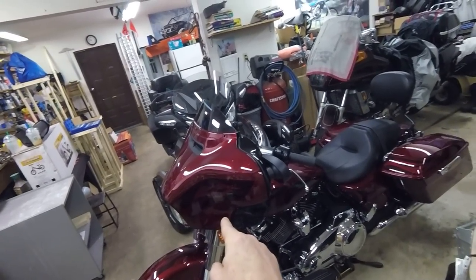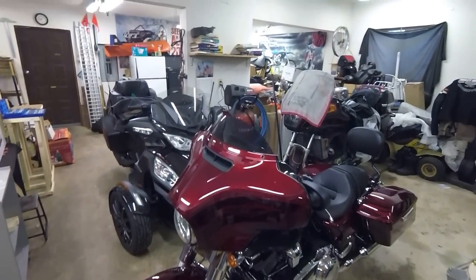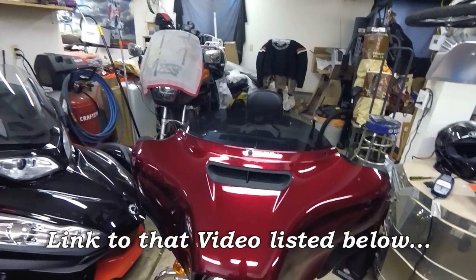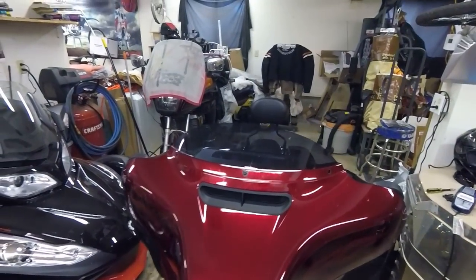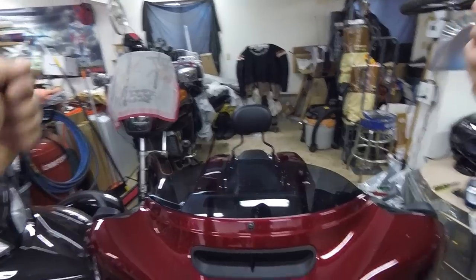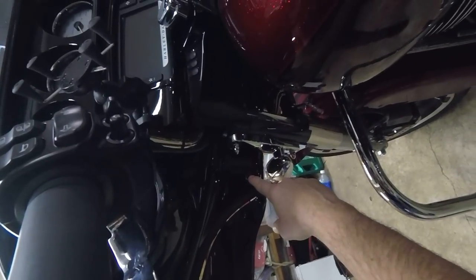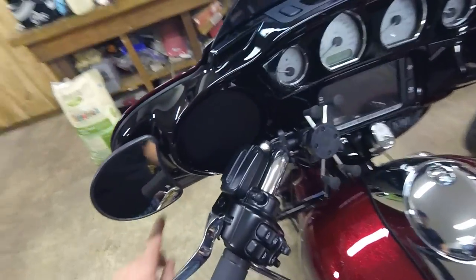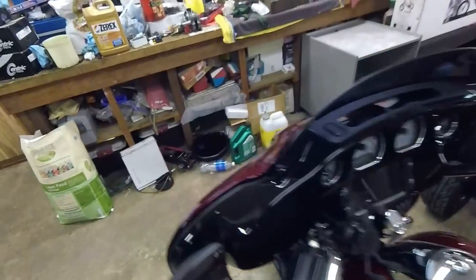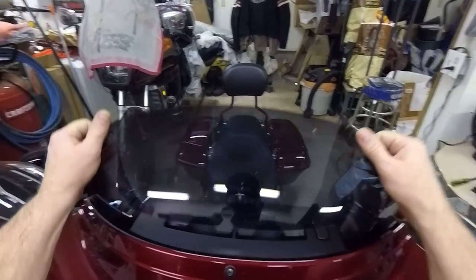The reason is the bike is pre-wired for the heated grips — I'll show you why in just a sec. First thing we're going to do is pull the fairing off. I already had this thing off; I did a daily vlog about the power outlets yesterday. The fairing is held on by three screws up top — lift your shield out — and then there's a screw here and a screw here: one, two on each side. Leave the center one in because it's holding the whole fairing on.